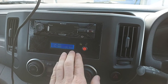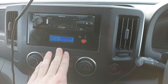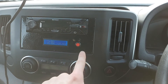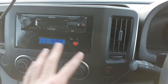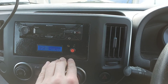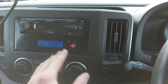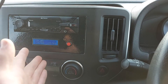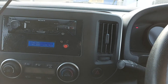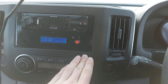It's great while I'm driving so I can see how much power overall is coming out of the battery. This button is here so I can switch it off. In a later version I'll have a system whereby if the 12-volt battery voltage goes below 12.6 volts, it will just switch itself off, because it's always over 12.6 volts when the van is on.